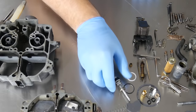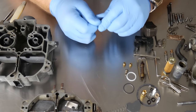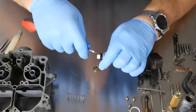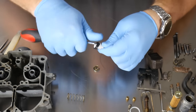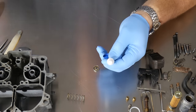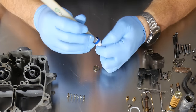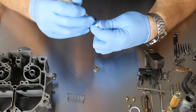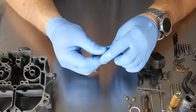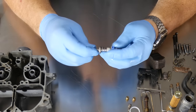The first thing I like to do is reassemble the accelerator pump piston. We need to bring the spring down so that little washer can fall out. Then we take off the old rubber part of the piston assembly and set the old parts aside. We put the new one on, shoot a little lube on it to keep it from galling, then take my little plastic spatula and put it over those four tongs — it's pretty flexible and forgiving. Now we just need to put our spring back on and slide it on.